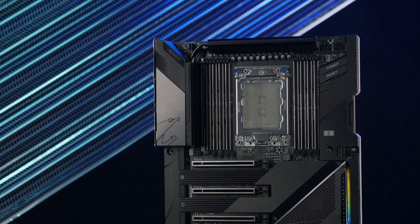Little things you wouldn't necessarily notice: most high-end motherboards have a heat pipe, and most of them are around six millimeters. We had to put an eight millimeter on this because it just has to be that one step above. That's kind of the Aorus difference — we took what we normally do on a high-end platform and just went one or two steps above that. This whole thing is powering your CPU. On the X570 we had 16 phases. This one we still call 16 phase, even though there's really 19.